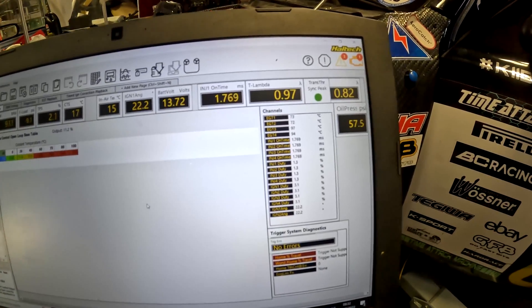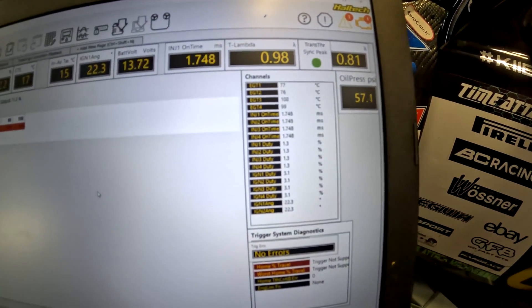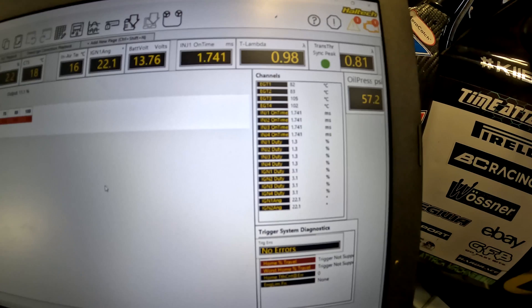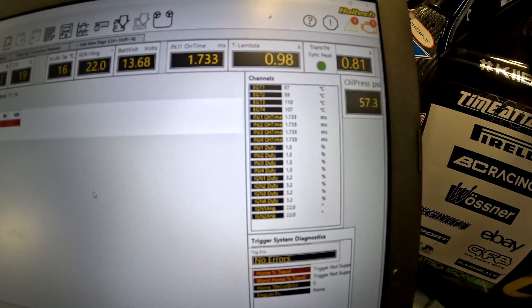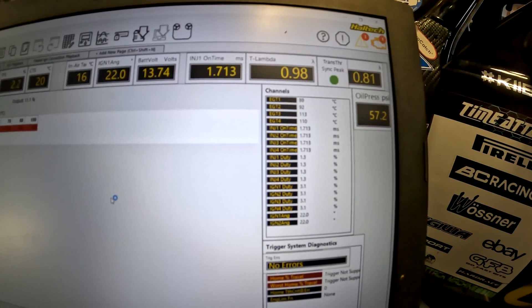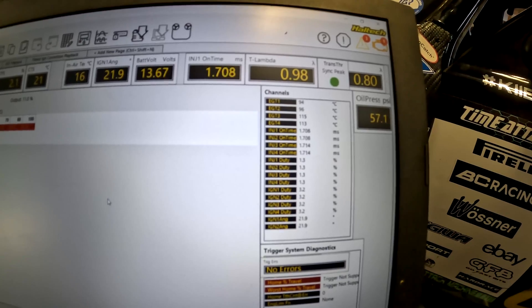As you can see, those top four black boxes are our EGT channels. EGT 3 is reading a bit higher than the others but we're still warming up, so it'll take a while for the temperature difference to level out. We're about 20 degrees difference between cylinders at the moment, whereas previously with the sensor at the wrong depth, cylinder two would currently be reading about 250 degrees hotter — a massive difference that was entirely down to the sensor not being at the same depth.